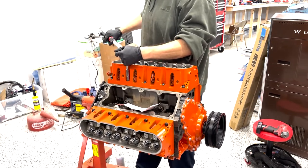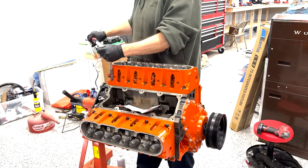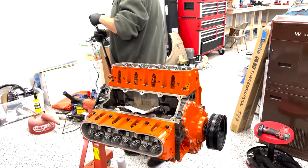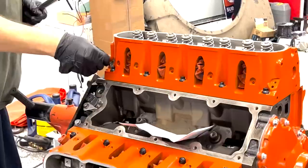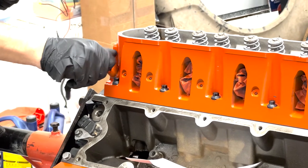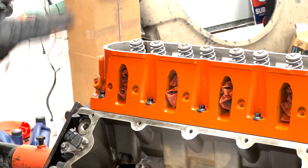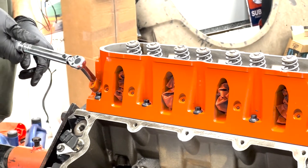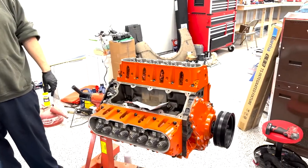It's okay — when you have new fasteners, they're meant to handle being run down a couple times. The last thing we've got is to get this little coolant plug put back on. I'm not using the rear bypass on this vehicle — we're going to run the front bypass using the factory piece. The engine is going to be tipped up in the frame so this one will be high, so we're just going to blank these off. And that should be good to go — ready to do some more work on this build.